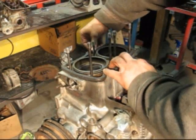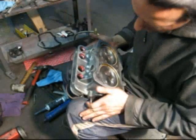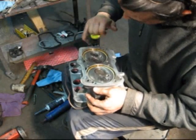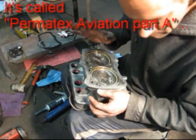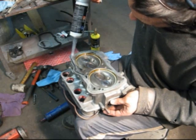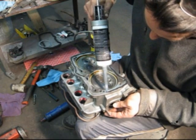That's the first step - really push carefully. Head preparation: this is a used AMC head with new exhaust valves, some work done on it. They were quite good. There's a head gasket, inner head gasket, and some stuff I put there that people don't always like, but that's my method. Apply the Right Stuff to those fitting areas all around carefully, just enough.